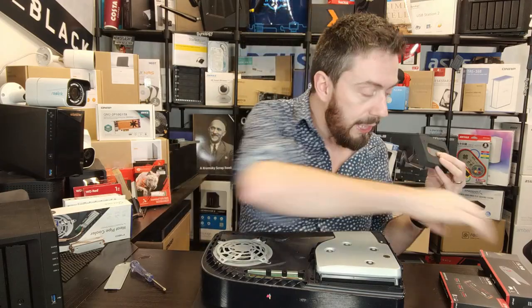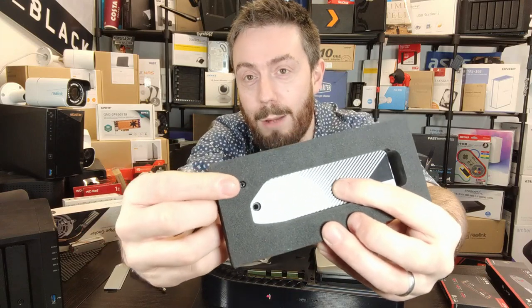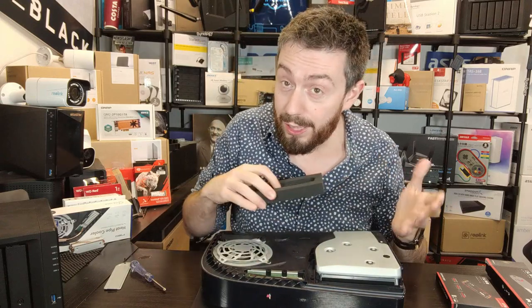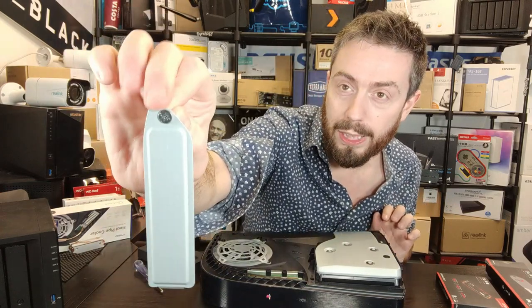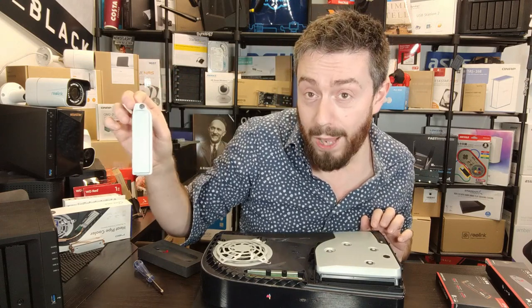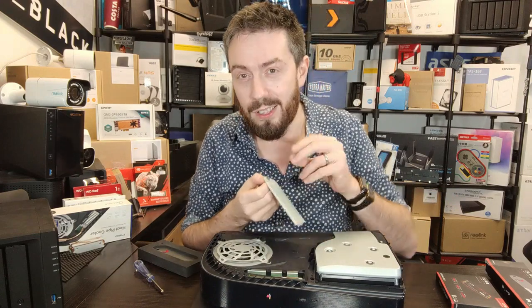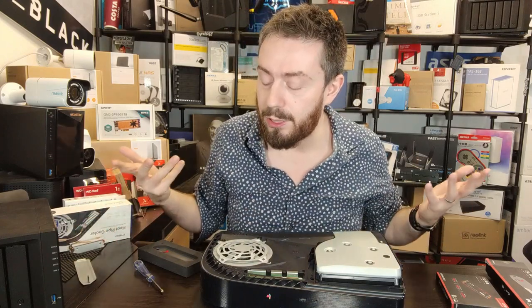I said there was two items inside. There's nothing else in the box. What there is, an extra screw, your M.2 screw, inside the box. Now, bear in mind, that is the M.2 screw for installing it inside the system if you need a spare screw. That is not the top screw there. It is not the one included with your PS5, the cross, triangle, circle, and square one. You still have to use the one that your system arrives with. And I know a number of you have already reported how soft that screw is and started ripping the thread apart a little bit. I'm amazed mine's still in one piece given how many SSDs I've installed in here.